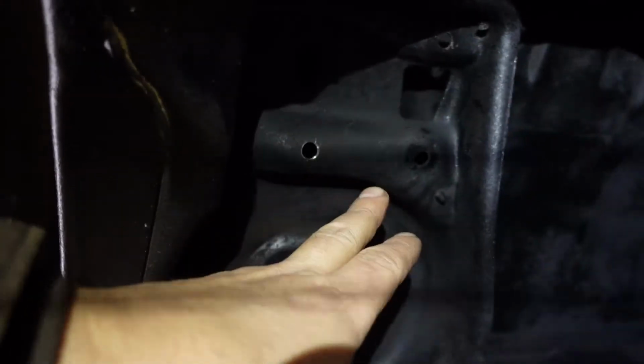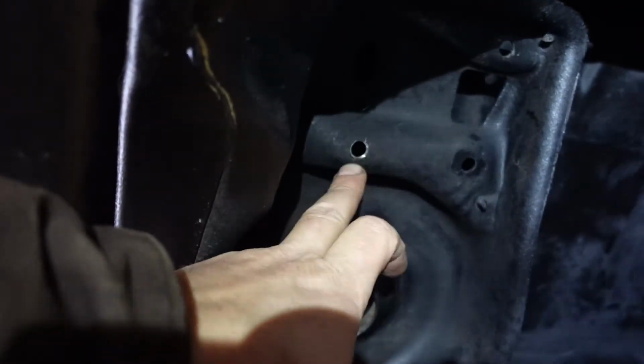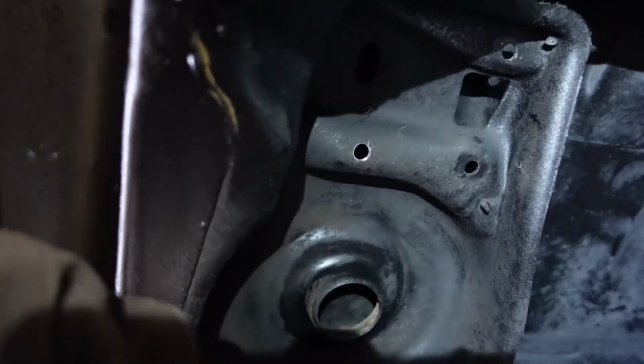So now, basically you put it in here, the stud goes in this rearmost hole, so the hole that's right next to where the gas tank's gonna go, and these other two just get regular bolts through them. So the stud goes through the top, put a nut and washer on there, and the other two bolts go through here. Again, washers on both sides of these, a washer and the nut on the top of that, and then the torque specs are in the kit.